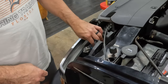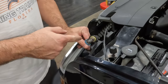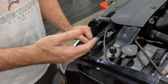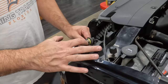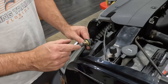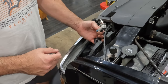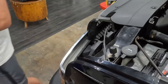So here's our high beam light, here's our low beam light. I'm going to throw some gloves on, because in case I want to put these back in — these lights are actually good and you don't want to touch the bulb. Just like I said, it's not as big a deal with the LEDs, but it's a much bigger deal with these. These xenon halogen bulbs get super hot, and if you get oil from your fingers on the bulb it will prematurely fail. Also because they're hot.